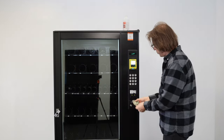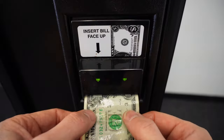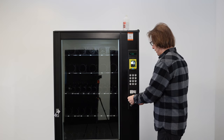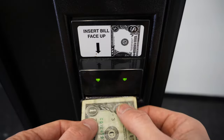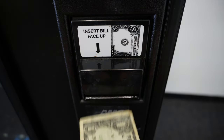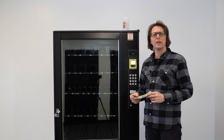Once you have the wet dollar bill, we're going to start to feed it into the dollar bill acceptor. I'm just going to insert it into the front of the bill acceptor and we'll pull it in, spit it back out, and repeat the process. I'm going to turn the bill around and stick it back in. Over time, it's going to pull that dirt off. As long as it's very damp and wet, you can insert it and kind of grab it and braise the bill — that causes the belts to skip on the dollar bill, hopefully wiping off some of the collected dirt. Continue this process 10 to 15 times; that should be enough to get most of the dirt off.